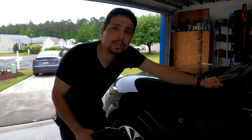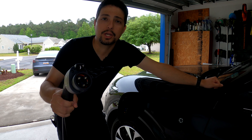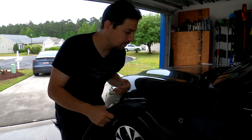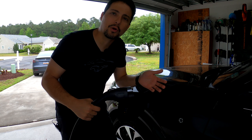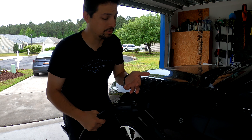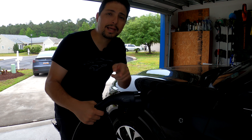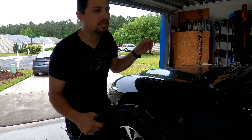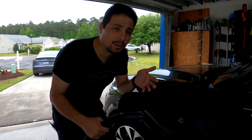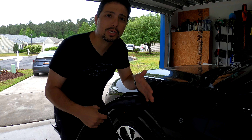We're down at our 2021 Ford Mustang Mach-E with the Apex Charger handle and J1772 connector. We're going to plug this in and check the insertion — make sure it feels proper, not too tight, not too loose. Then we'll start the charging session, take some baseline temperatures. It's about 65 degrees outside today. We'll take those baseline temps and then run three hours of charging to see how well it performs.